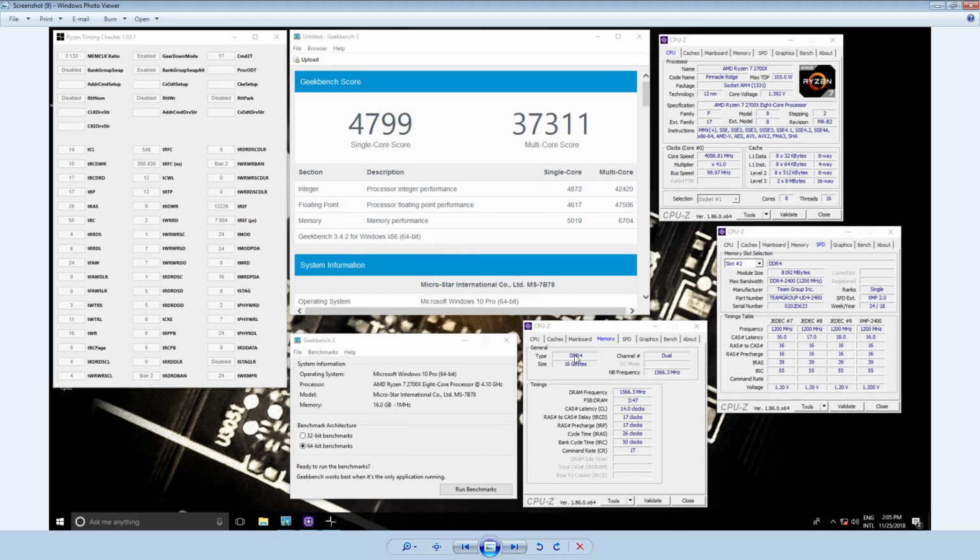Yes, it can. And here's where it actually maxes out. These are settings that should be pretty much close to stable. I've stabilized similar settings in the past for my APU overclocking video, where I had 31, 33, CL14, 17, 17. I basically copied my primary timings from my results for that video. As you can see, we're getting 6,704 points. So we're beating that Antec Series 3 B-die kit by 200 points, while being 200 to 300 megahertz lower clocked.